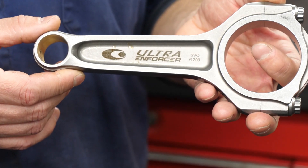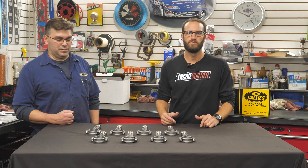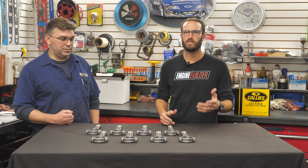The design of Ultra Connecting Rods has been engineered to enhance the rod against specific loads and stresses applied during high load and high RPM applications. Ultra Connecting Rods are fastened by high alloy cap screws made specifically for severe duty service from ARP, which provide a smoother, more consistent clamping load. But if that isn't good enough for your application, a bolt material upgrade is also available.